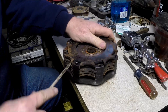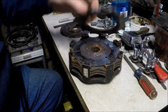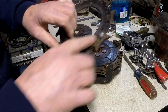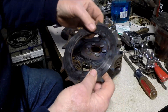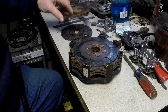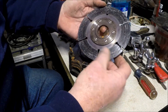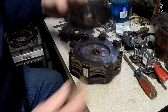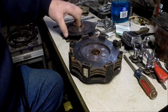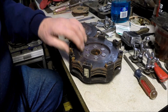With a little effort we get this first plate out. These are the steels, and they lay in there and clamp the floaters. These things are all rusty from sitting, but those discs slide against this surface when you're releasing and engaging the clutch — that's what gives you the action. Here's another clutch disc — it's certainly seen some wear; I wouldn't run that again. One thing to note: these discs have a hub on one side and rivets on the other, so you've got to make sure you stack them properly so the hubs don't butt up against each other.